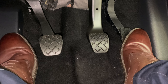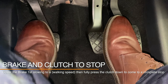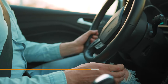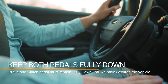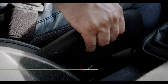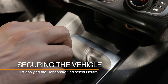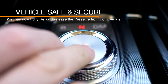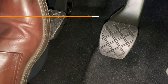In a manual car, to come to a complete stop, we gently push the clutch fully down and apply gentle braking progressively to come to a complete stop. Once the vehicle has come to a complete stop, keep pressure on both pedals until we have made the vehicle fully safe. Firstly, secure the handbrake. Secondly, secure neutral by selecting it with the gear lever. Congratulations — we have now fully completed securing the vehicle and can fully relax and release the pressure from both pedals.